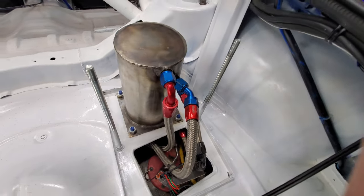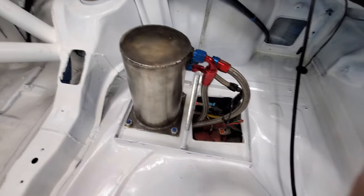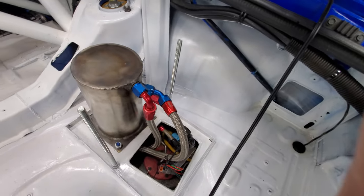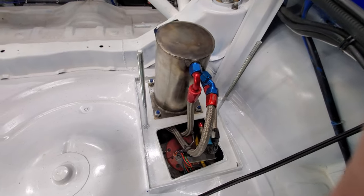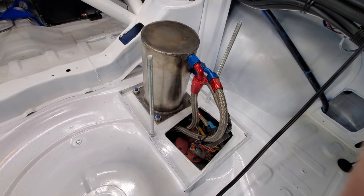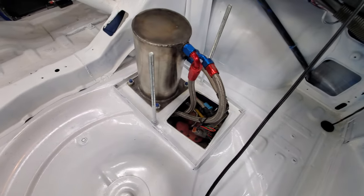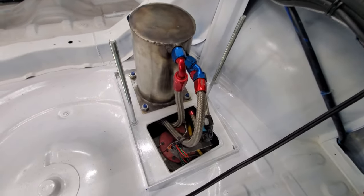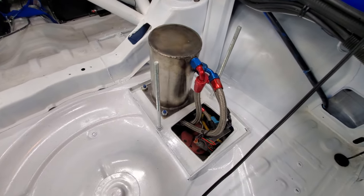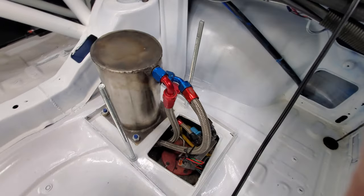We never have to worry about it ever again, and ultimately this is a great little modification. So take a look, guys, if you ever want to build something like this. You certainly can build them yourself. You definitely want to make sure it's fuel tight and whatnot. Just keep in mind, try to keep it isolated from the inside — that way you don't have to have a massive firewall or something. I get a little bit nervous anytime I see a fuel system inside of a vehicle just because, well, it's fuel inside the vehicle. The better solution is always try to keep it on the outside of the car, even with the fire suppression system. But I thought I'd give you guys just a quick rundown on this — thought you'd get a kick out of it, at least see it and learn a little bit about it. There you go, guys. Thanks for watching.